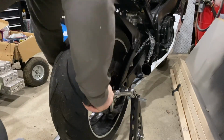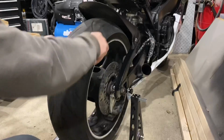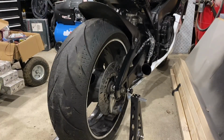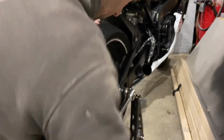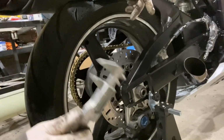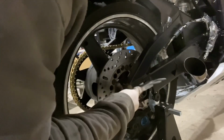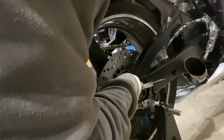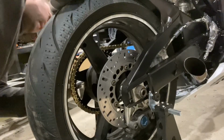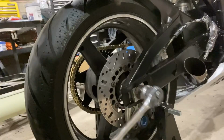We're just gonna loosen this off a bit so we can slide the rear wheel back. There we go. We'll tighten that back up now. I'm just gonna nip it, I'm not gonna overtighten it. So I'm just gonna use this to check the distance between. It's a bit tight to get in there. But it looks to be 14mm. We'll double check this side. 14mm, yep. We're about right at that. So let's nip it back up.